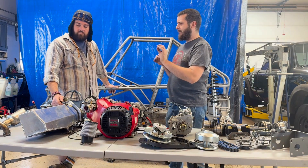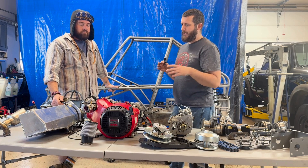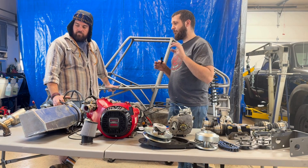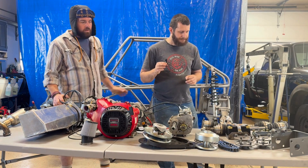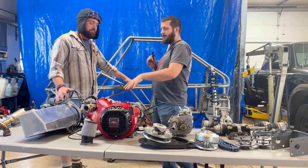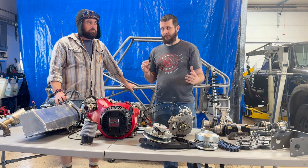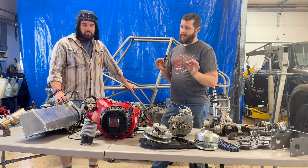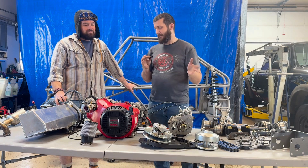Chad mentioned the exhaust — the stock exhaust tube was about an inch and an eighth OD. Because we ported the head and gave it larger flow, it actually increased to an inch and a half diameter. So I had to fabricate a whole new exhaust using stainless steel pre-mandrel-bent elbows, and then threw on a good old Amazon Chinese muffler for great sound effects. The exhaust manifold gasket — because everything was bigger and the ID of the hole was bigger — I had to come up with a gasket. Luckily I've got some resources, meaning my wife. She was able to use a Glowforge to CNC laser-burn out the gasket, which definitely helped me out because I didn't want to sit there with an X-Acto knife trying to cut out an exhaust gasket.